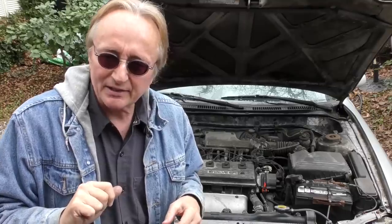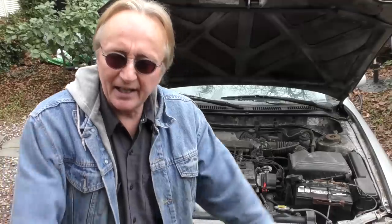On really modern cars you've got to buy the right injectors, and you even have to run a computer program to make the injectors work with the computer system and all the sensors — it has to be set up with a computer. You can't just pop the old ones out, pop new ones in, and drive away; it will not run correctly. But on really high-end cars like a V12 Audi — I watched a guy replace an injector once, it was like a 20-something hour job — guys will replace one or two if they're bad and then use the computer to reprogram the whole system so it calibrates that injector to work the same as the others.